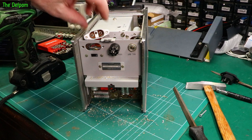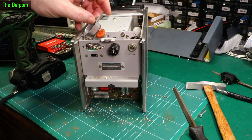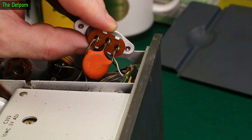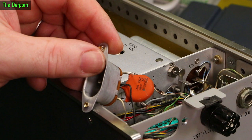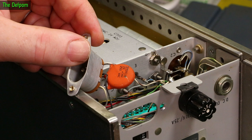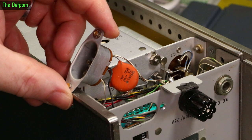I've just finished drilling out the rivets and there's a capacitor on the back of here — I probably should replace that as well. This is the original capacitor on the back of that socket — look at it, it's actually got three legs on it. So it's obviously purpose-designed for this particular function, it's not just a standard capacitor. And it's actually marked as 2x 250 volt AC. Now 250 volt AC could be borderline for me — my line voltage here is often about 240 to 241. Is this an X-class cap? Is that 2x class together?